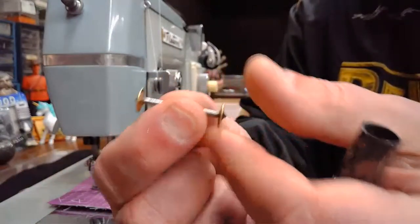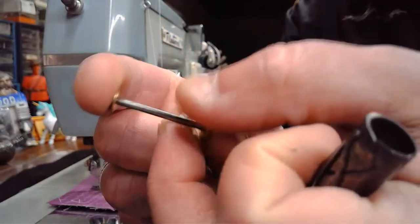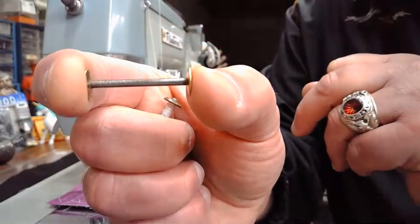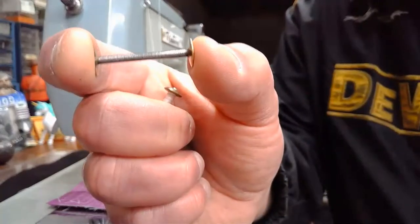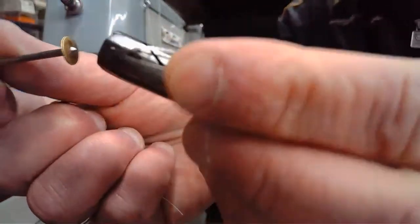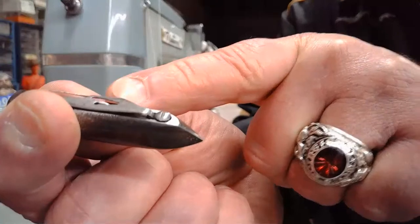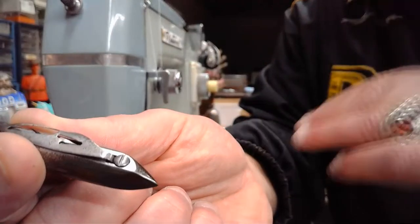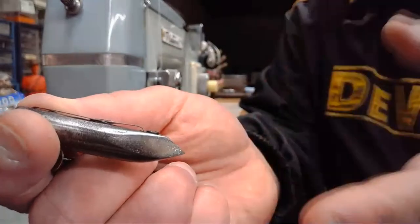Also, the barbell bobbins that are used in these types of vibrating shuttles that Paula mentioned are able to hold a lot of lighter threads. But if you tried winding one of these with size 138 or size 207 thread, if it would work, which it wouldn't, because as it's feeding from this barbell bobbin inside of this vibrating shuttle, it's trying to work its way underneath that real tight little band right there and then come up through this hole right here. It would be so tight that you'd have a lot of thread breaking, and it would be a nightmare. So unfortunately, this type of system with a vibrating shuttle is not ideal for heavier threads.